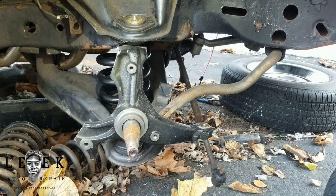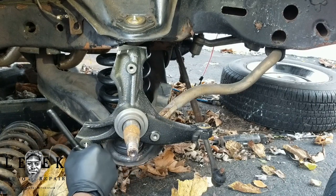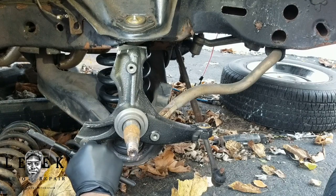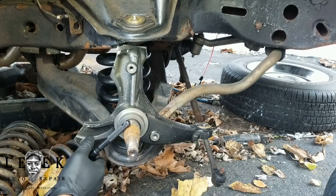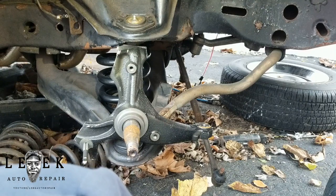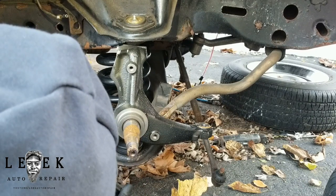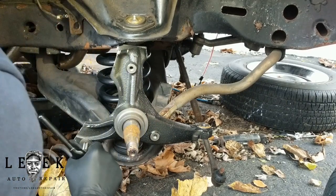Getting started in the hole — you may have to work the drill bit around in a circle to open it slightly. When you start tapping, make sure the tap goes in straight. If it goes in crooked, the threads will be crooked and the bolt won't sit right. Eye it up a couple of times — it's definitely going to take a few tries to get it started. Go extra slow and go back and forth to make sure your first few turns are straight.